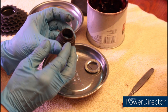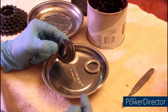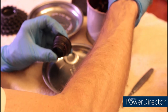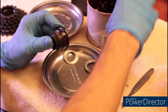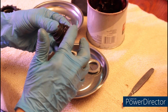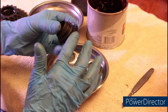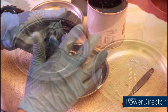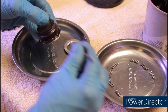There we go. Next, we're going to wipe a thin film of grease on the race at the bottom. The bottom race on this unit gets 41 bearings. The top race gets 31. If you're unsure about this, count them as you disassemble it. The easiest way I've found to reassemble these is with a pair of tweezers.